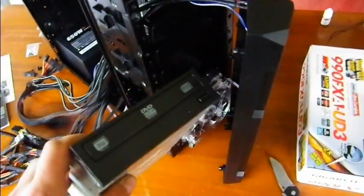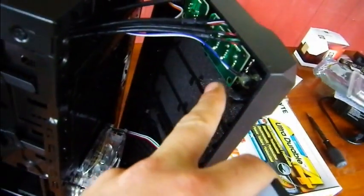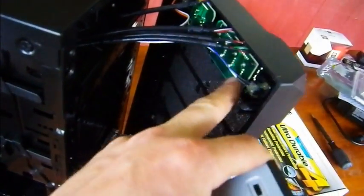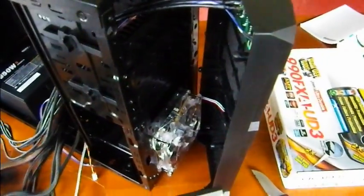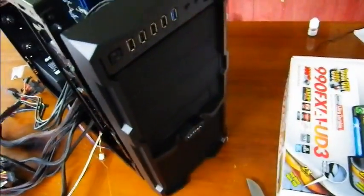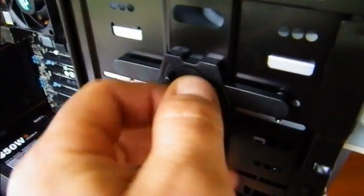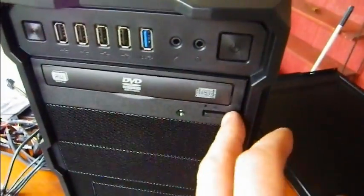To put your CD-ROM in there you have to break these out in the front. The front of the case has all the USB connectors and the audio stuck to it, so it all comes off — you have to give yourself some room when you plug everything in, or it will be a pain to add other interfaces later, like an SD card reader. The front of this case also has filters in all of its little holes, and down here at the bottom where that main fan is, these little things slip in there. Lock your drive in — I think I'm going to stick a screw in it. Luckily you can pop both sides of this case off and it will allow me to put a screw in right here.